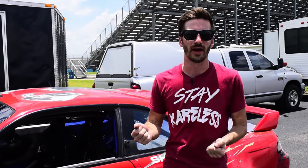Just finished the shakedown. I finally felt a difference, though I've been talking about how I have the worst butt dyno ever — it's hard for me to tell small changes, or even larger setup changes, because I'm so used to driving around problems. Even though this was a massive spring rate change, I only noticed slightly sharper turning and a little less brake nosedive, but not enough to make me say 'wow.' I couldn't really feel the drive out of the corner like I was looking for.